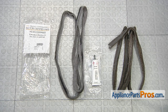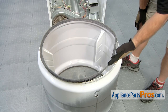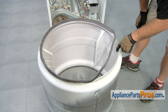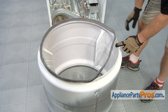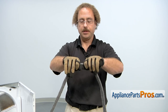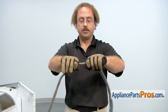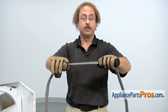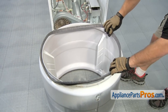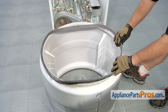Here's the old drum felt seal next to the new one. You can get it at AppliancePartsPros.com. As you're going around the felt seal — we're just trying it on to show you — sometimes due to manufacturing, or the fact that it's a little dry or shrunk up, it'll be very hard to get the last little bit on. So what you can do is take it back off and very carefully hold it with some tension and stretch it out just a little bit. You want to stretch it and try it a couple times because you don't want to stretch it too far — you're not going to be able to take material out if you stretch it too much. Once you try it and get it to where you need, when you put it on, you want it to go on pretty easy up until the last point, and then you can put the last section on and it'll be tight.